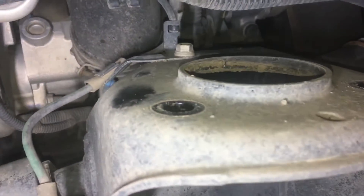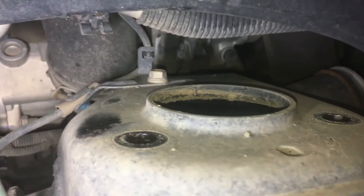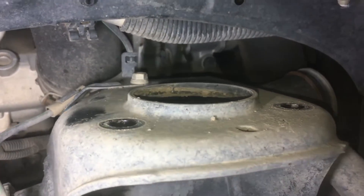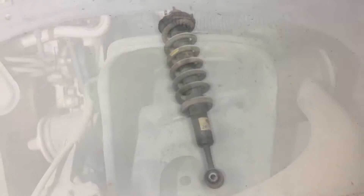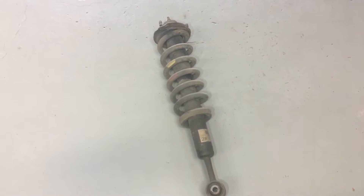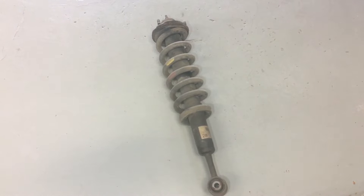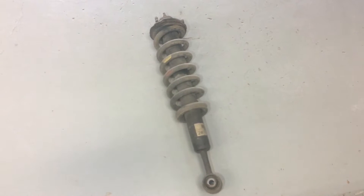This is obviously what it looks like when it's out — you've got the hole in the middle for the shocker rubber and the centre of the shock or strut or coilover, whatever you want to call it, the three empty holes where the nuts go. Just looking straight down to the floor — bang, straight in and out. That'd be why this one's laying on the floor, because we just dropped it straight out. The arms drop straight out too — pull the two bolts out, straight out.